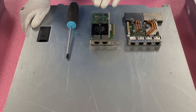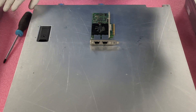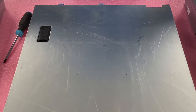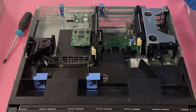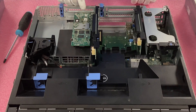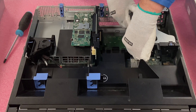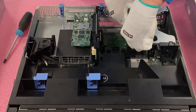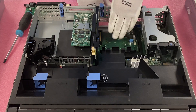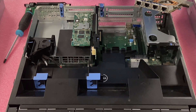We'll install one daughter card and one PCIe. You will need a screwdriver for the daughter card, so I just wanted to point that out. We're going to go ahead and take the top off. In order to install the daughter card, we're going to want to remove riser 2. We'll pull riser 2 out — it can be a little snug, so slowly work it out — and then we'll come in and install the daughter card itself.